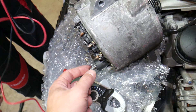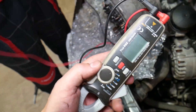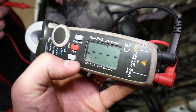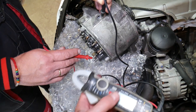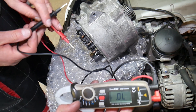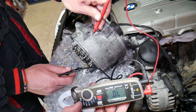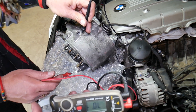This is the 12-volt wire on a good alternator — the charging wire. We need a voltmeter; we'll have the link in the description. Turn it to diode testing function. Touch the black lead on the casing — scratch it a little if there's corrosion — and the red lead on the positive charging wire. Nothing happens — that's how it should be. Now switch them: red on casing, black on charging cable. We get about 540. If you get a reading between 500 and 800, that's how it should be. Switch them again — zero reading. That's correct: when the car is off, electricity should not flow back.